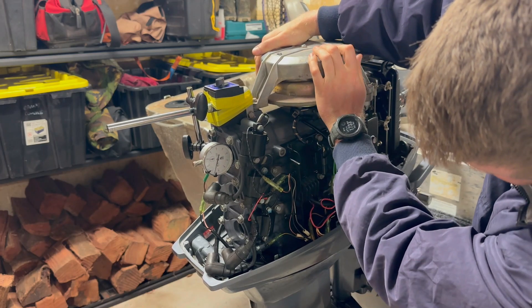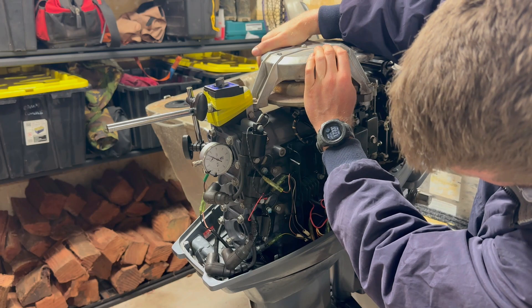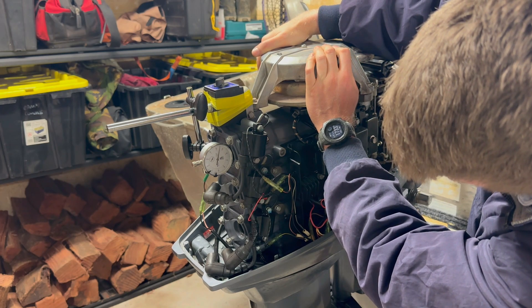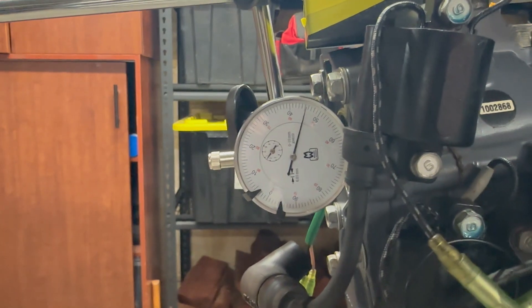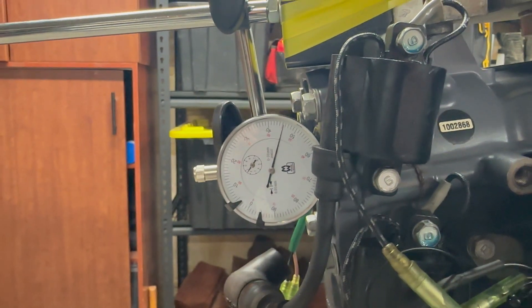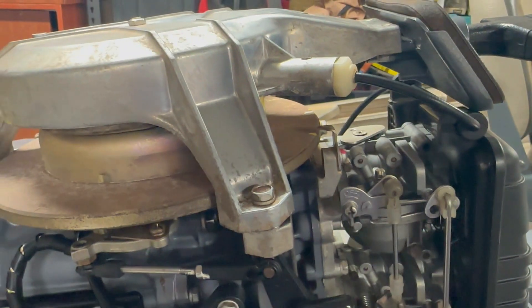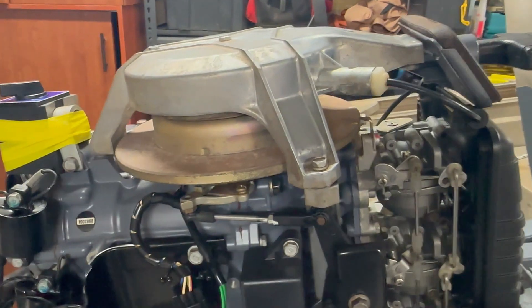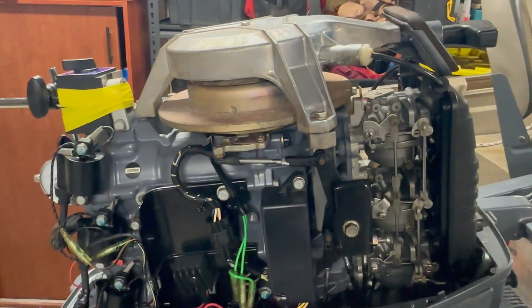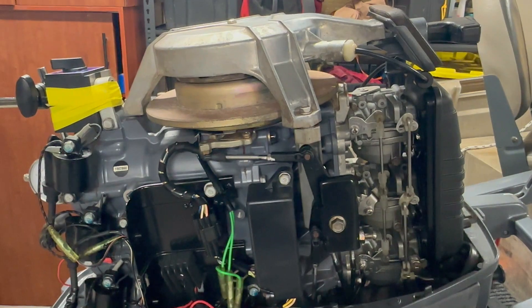Continue to turn until we pick it up — should be pretty close now. This is 3.55 millimeters before top dead centre on the number one piston. What we're checking is that this pointer here aligns with 25 degrees before top dead centre, with the markings on the flywheel. My pointer lines up perfectly, which is what you'd expect from the factory. This step only accounts for any big knocks to that pointer, but it's still good to verify before undertaking the other steps.